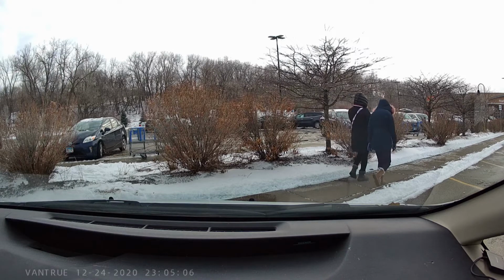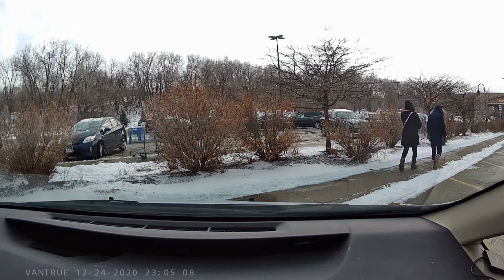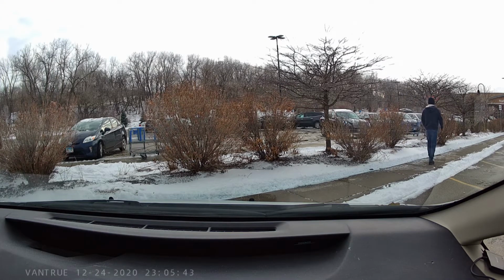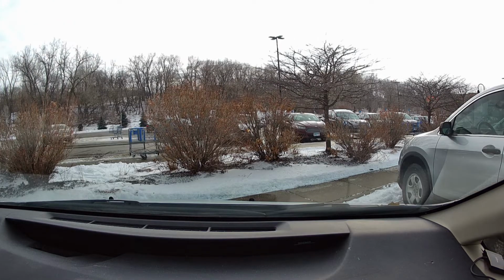Now when it comes to the parking mode, it's a nice feature to have, but it's not buffered like a lot of the advanced Korean dash cameras or Viofo's parking mode 2.0. What buffered means is when it detects motion or an impact, it'll actually trigger the previous 5 or 10 seconds to save and then continue to record for some certain amount of time depending on the camera or what mode you're using. So the issue with this parking mode is when it senses motion, it doesn't start recording until a moment after.